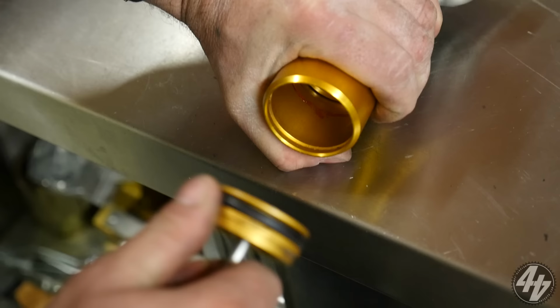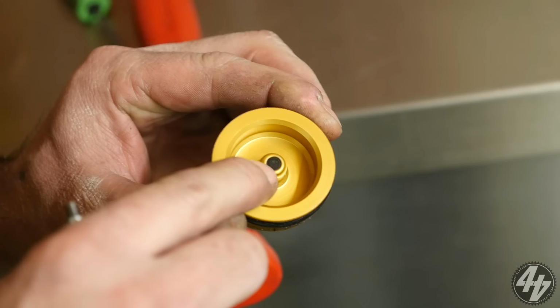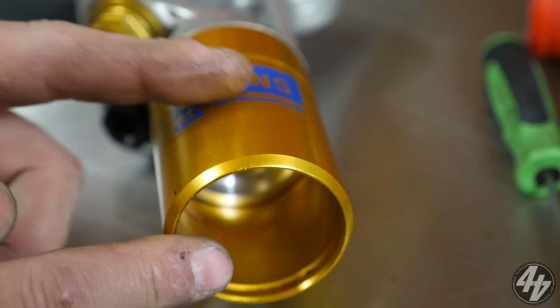So what have we got in there, then? Right, so this is the bit that Alistair was concerned about. I put the needle in there. On the other side, it's a rubber. Right, okay. It self-seals, a one-way valve. This whole thing is just to hold gas, between that piston and that cover that was on there. Okay. So what does that gas do? Well, that gas will pressurise this, put pressure against this piston.